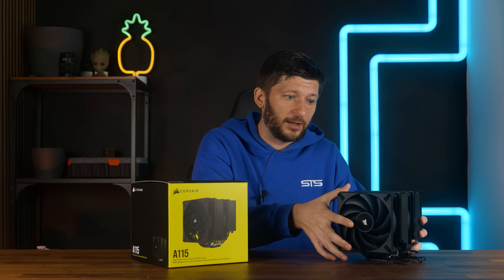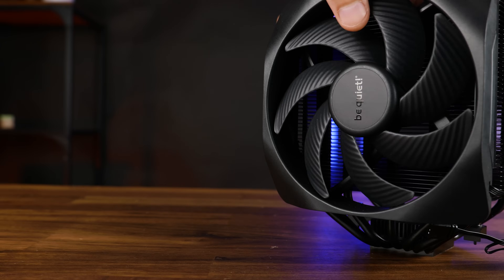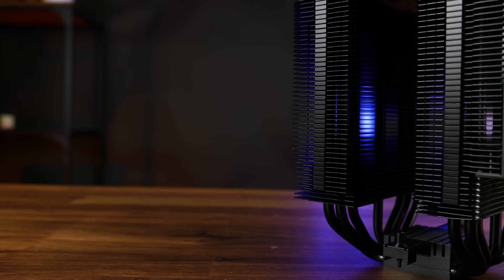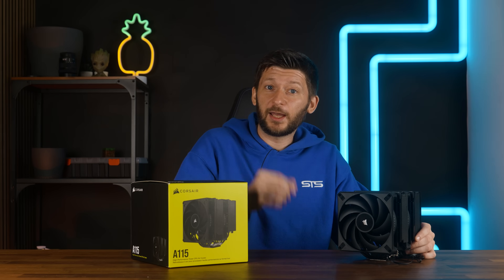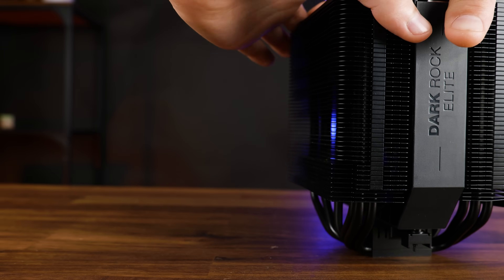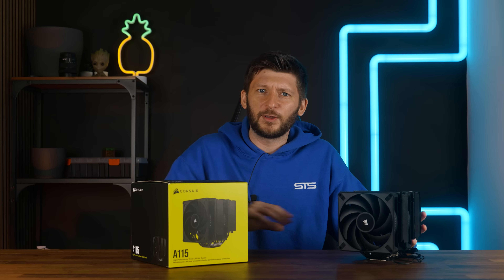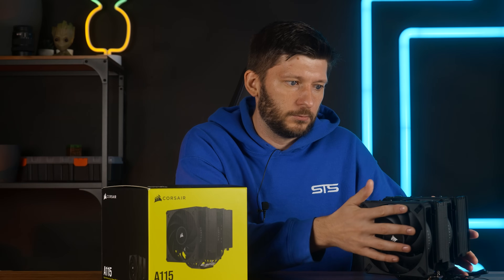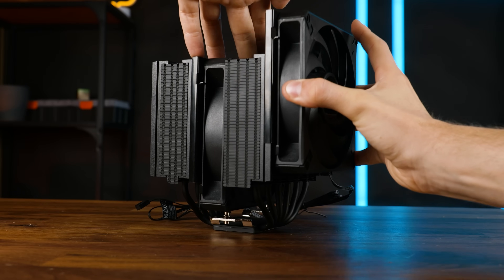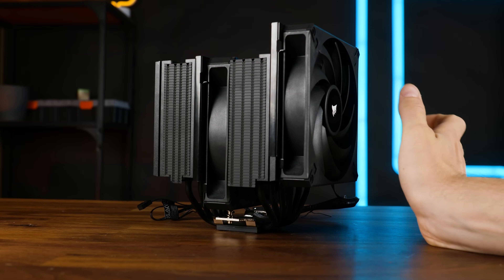Moving this up and down doesn't feel like I'm hurting my system. And because these are standard fans, these are also standard holes, which can't be said about the Dark Rock Elite — there, everything is pretty much custom. Even if you can technically remove the central fan, replacing it with anything that fits is an endeavor in itself. This is definitely the better approach. Installing and removing fans doesn't feel as brutal as it did on the Elite, and I can swap out the fans for any standard 140mm fan.